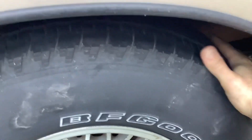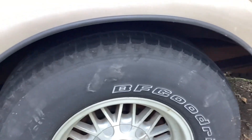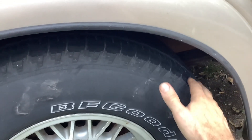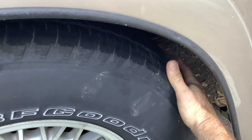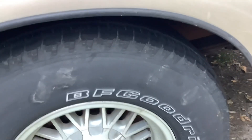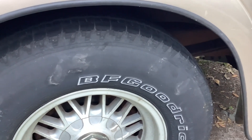The tread depth's not great, but you also want to take your hand and feel along the surface of it for any cupping or bulging on the tread of the tire. On this particular tire, I felt around multiple times along the tread and didn't feel anything until I got pricked with a little piece of metal toward the backside of the tire tread. When I felt in there, I found that the tire had separated in between some of the inner treads.